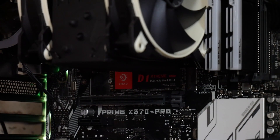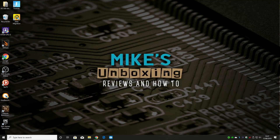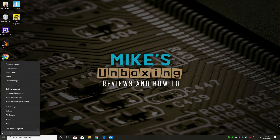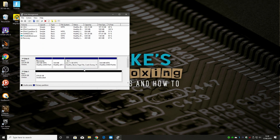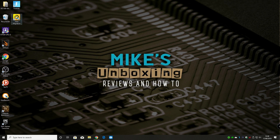Now we can reinstall the graphics card and return to Windows to copy our operating system. We're back into Windows after reinstalling the drive. First, we need to initialize the drive - right click on the start bar and go into disk management. Straight away we get the initialize disk notification. We'll set disk one as GPT and click OK. We can see our unallocated disk at 476.92 gigabytes. We're going to be transferring the C drive onto this disk, so we can close this and open the data migration tool.